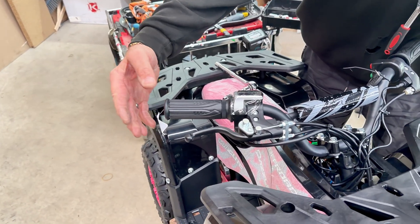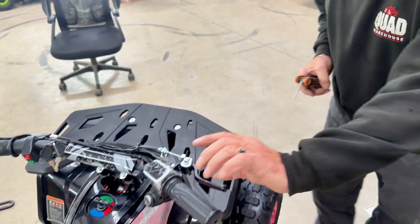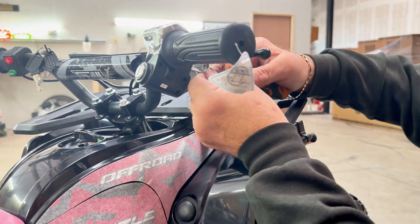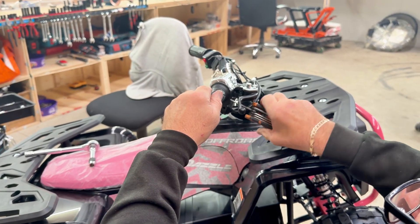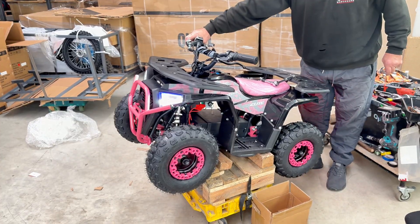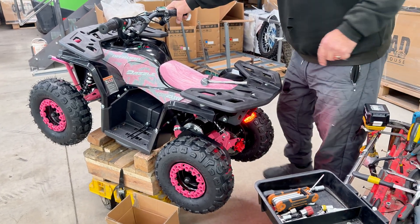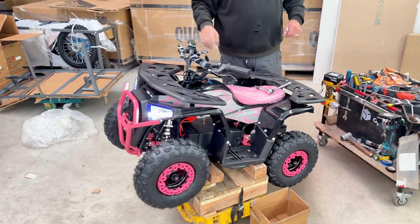Check the throttle — if it's sticking it's been pushed on too far. You'll have a little Allen key in your toolset. Underneath the throttle there's a little hole with an Allen key in it. Undo it, pull the throttle out just a touch, then tighten it back up and it should be free. You have a set of keys that's tie-wrapped — snip them off and put them in. When you turn it, your light should come on. Make sure the brake lights work — if they don't, a connection isn't connected somewhere. When you put the brake on it automatically shuts the motor off. If the brake light doesn't come on it won't shut the motor off and it will keep going, so that's an important safety check. Apart from that, everything's done and it's good to go.